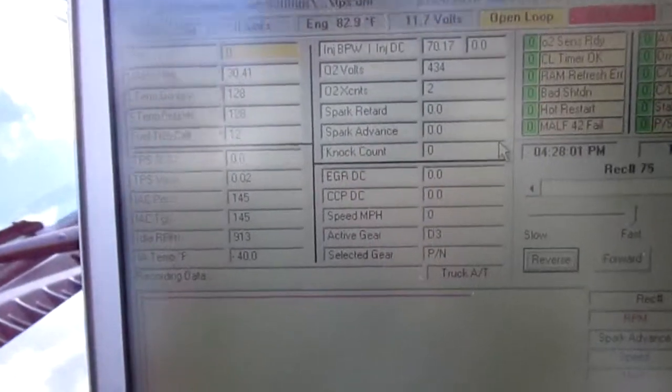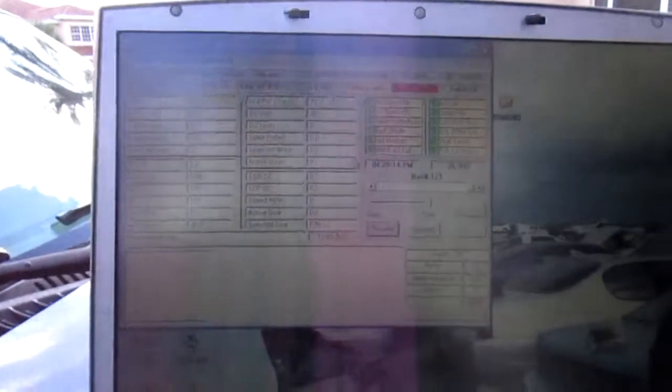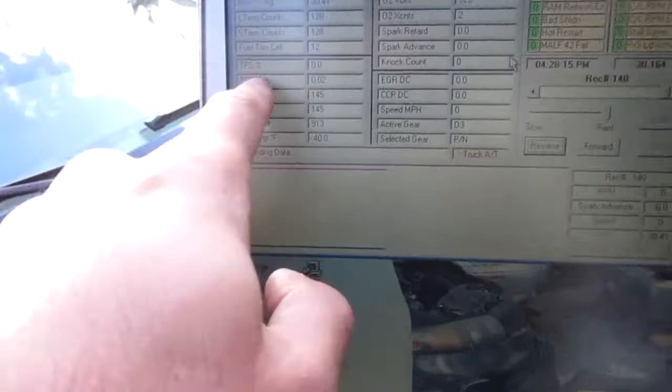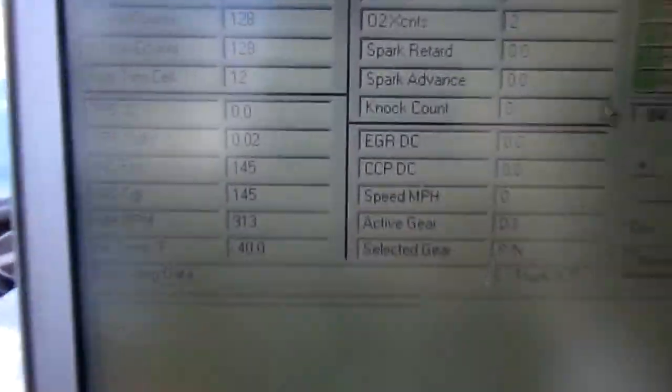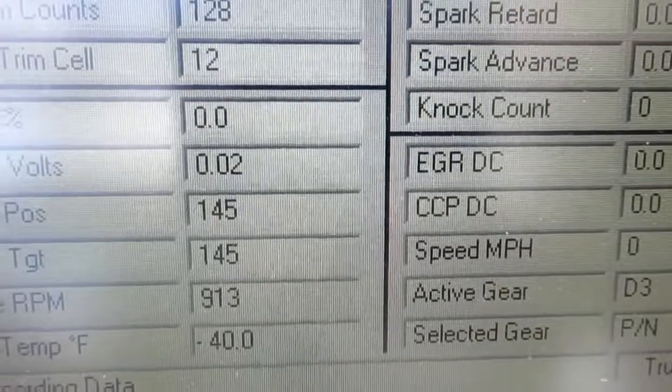We are connecting. So what we're doing now, we got a key on. We're adjusting a throttle positioning sensor. I want to try to get this voltage correct. It should be showing nothing now though. Where's TPS? Let's just see where it is. Throttle positioning percentage. Okay, in the volts. So reading point... residual voltage. What? I don't have it hooked up now. That's weird. It's moving.